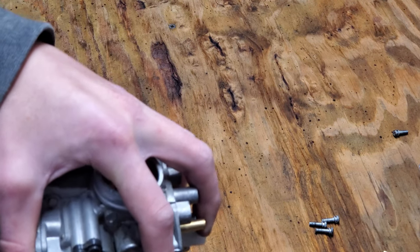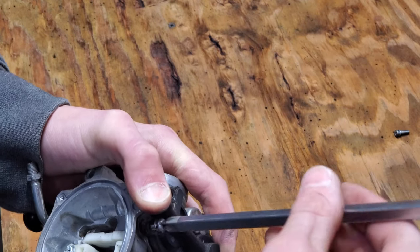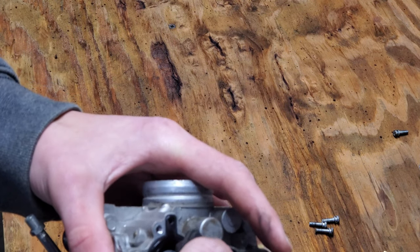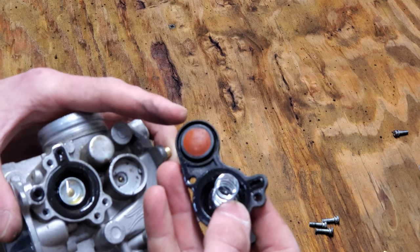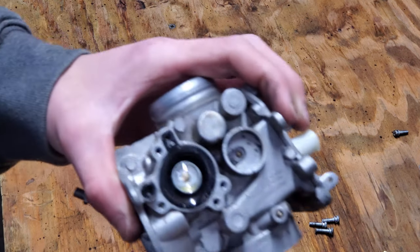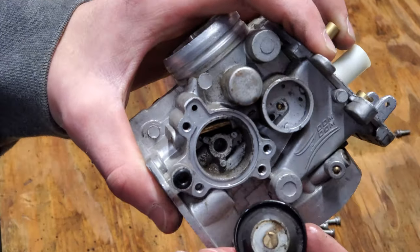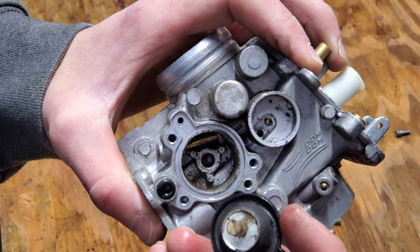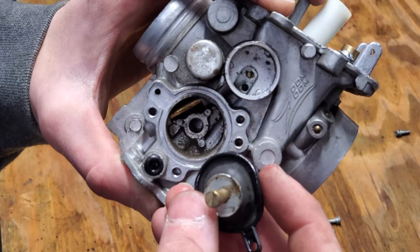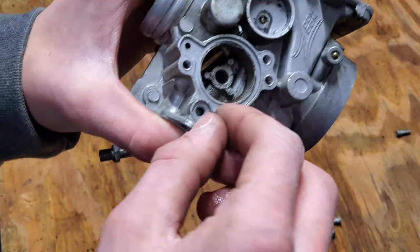Take off this diaphragm cover with these three screws. Be careful removing this because there's a spring under there that'll shoot out — I'm holding this cover down as I'm taking the screws out. Now that those are out I'll pop this off. See in there it's a bit dirty — blow that off with compressed air because we don't want to use carb cleaner on the rubber parts. Here's the diaphragm — I believe this is for the choke — check and make sure this isn't ripped either. And there's a lot of dirt inside of there, so I believe this is my issue. I can't give it more than about half throttle or it'll bog down, and I think it's engaging the choke. That's a lot of dirt in there that shouldn't be there. I'm going to clean all this off with compressed air, and don't lose this o-ring that goes there either.